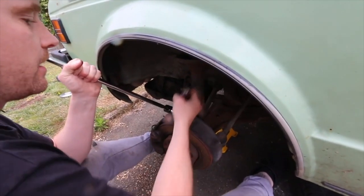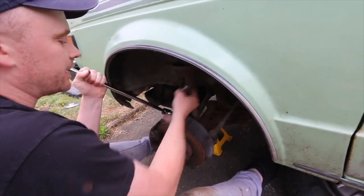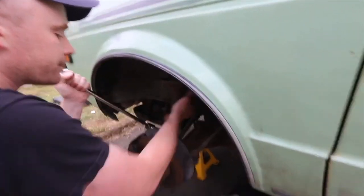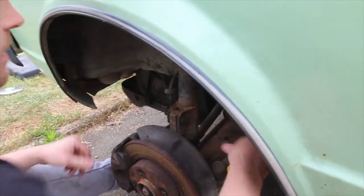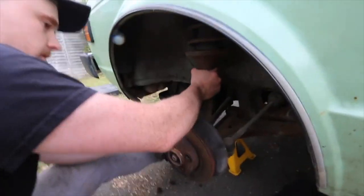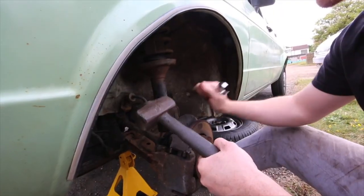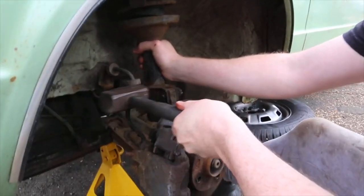The top one is just the camber bolt. We're not going to be too fussy about camber because this isn't a 120 mph car — just pottering around the Isle of Wight doing 30-40 mph. We'll try to get the camber the same as before; otherwise if you want to take it to an alignment shop, do that. Using a lump hammer — medium to small size, didn't want to bring the big one in case it breaks something.